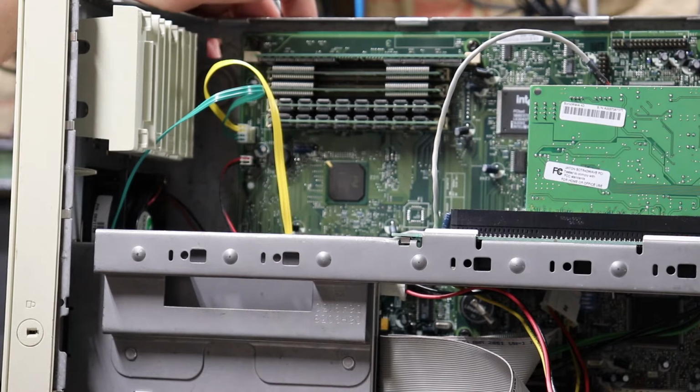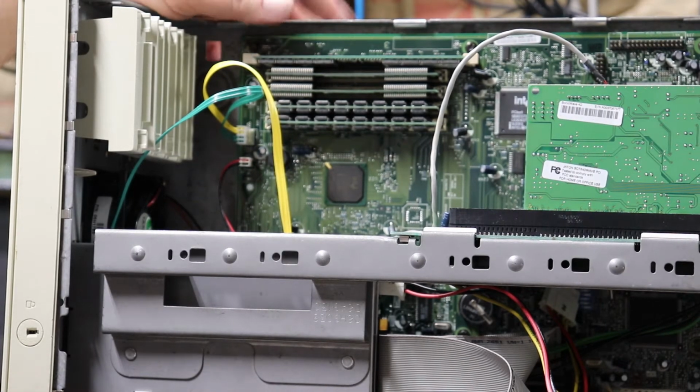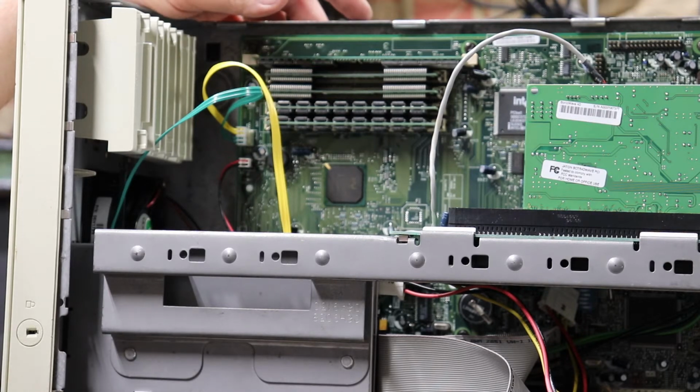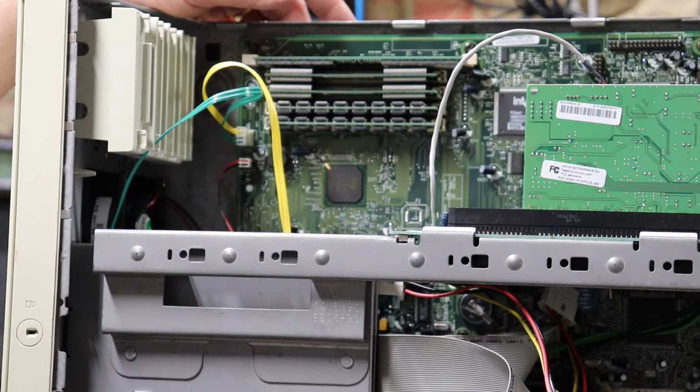I literally pulled the board out, well, as you saw, pulled the board out and I sprayed it down with basically Simple Green on steroids, that green cleaner. It's called Purple Power, I think. But you gotta be careful with it. As I discovered, it has a little bit acidic properties to it. So you don't want to leave that on too long. Bad things could happen. Corrosion.